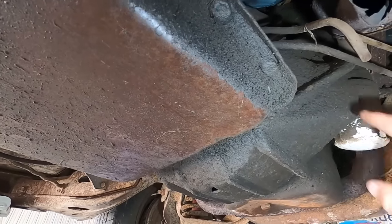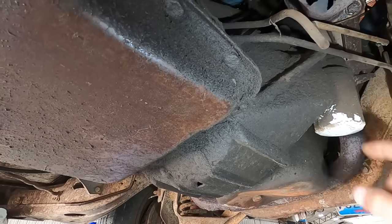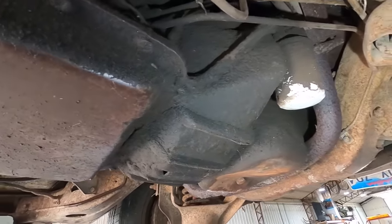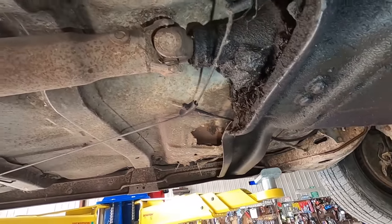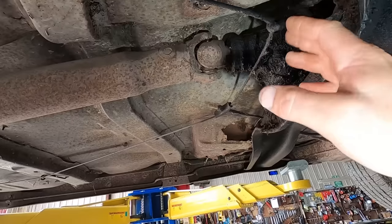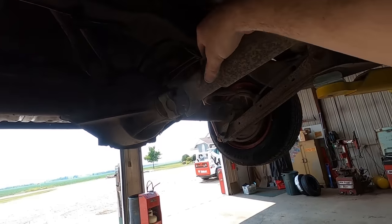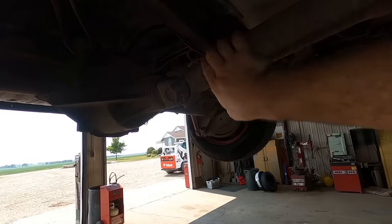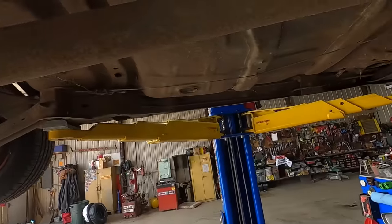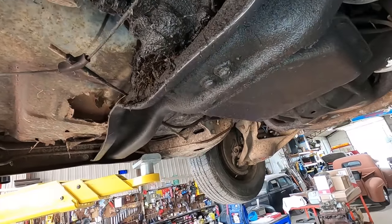There's two patterns. There's a small block Chevy pattern, and then there's the BOP pattern. So obviously, being an Oldsmobile, that's the O in BOP. So we need to go see if we got an Oldsmobile Turbo 350 laying around. The tail housing isn't so important, because since this is the shortest one, we can always shorten up the driveshaft. But as noted earlier, this one doesn't bode well to shortening with whatever sleeve they got in there. So let's go see what we got in the stash.